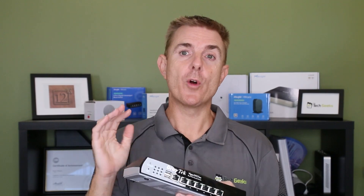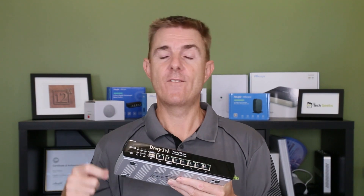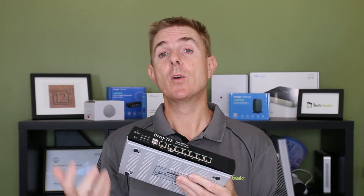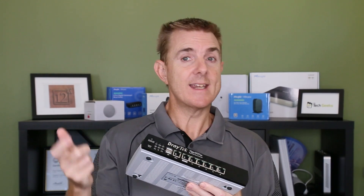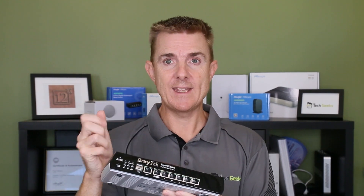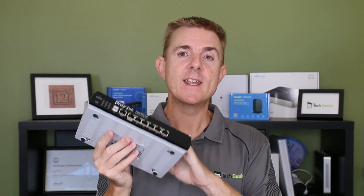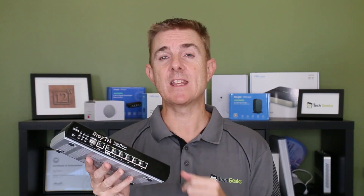Looking at the unit itself — this is a seven port router. It's got one dedicated WAN port and a second configurable port, so you can have one WAN and six LAN, or you can have two WAN. It supports failover. There is also the option to run USB for maybe 4G — it does work but we probably wouldn't recommend it. It does basic firewalling and packet inspection, open and close ports, and it does VPN. It will also manage Draytek access points if you have other Draytek access points.